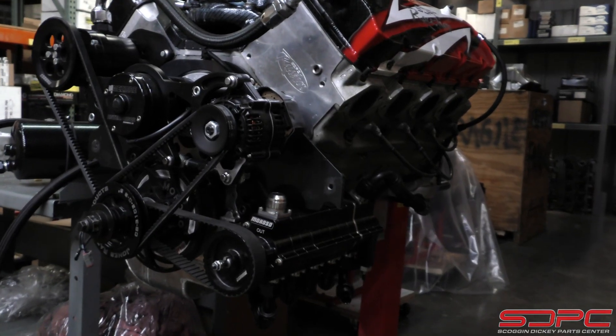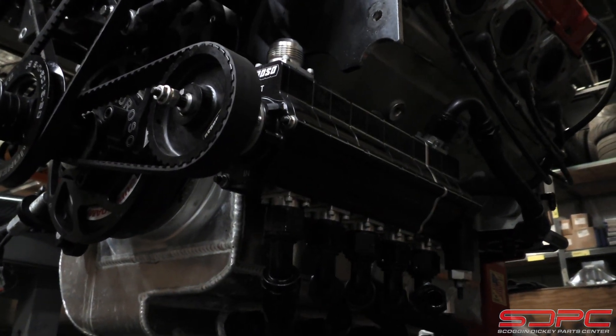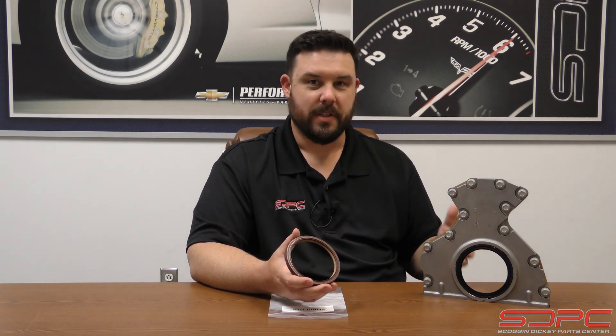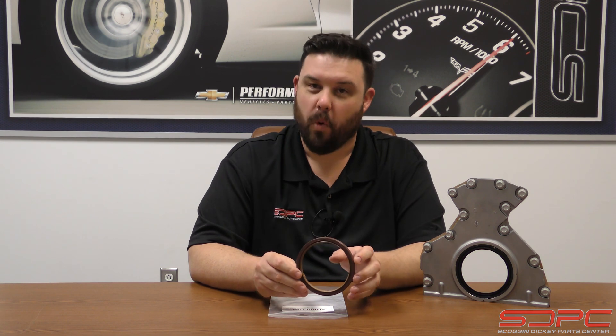This isn't exactly a street topic — most 99% of you street guys will run the stock seal and you'll be perfectly fine. But for your racing guys on the LS and LT platform, this is going to be a big help if you're running vacuum pumps or dry sump setups. They pull a lot of crankcase vacuum as well, and can run into the same problems with the stock seal distorting on the crankshaft. If it's distorted and run through temp cycles for too long, it actually loses its ability to seal entirely. And you will find in the paddock at idle, you'll start developing some oil leaks.